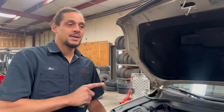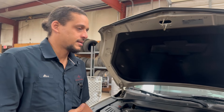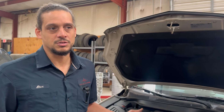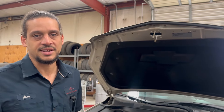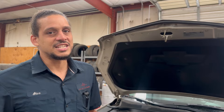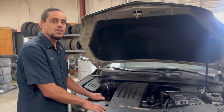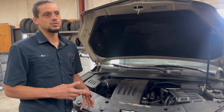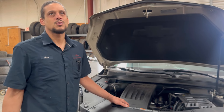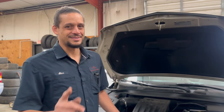I'm going to do an honorable mention because I don't see it a lot in my shop, but these engines do like to consume oil. Let's say you have 6,000 mile oil change intervals using synthetic oil — you're not going to make it to that 6,000 miles without adding two to three quarts. That's an issue. What you can do — I always recommend to my customers — if it is consuming oil, you most likely have piston ring issues or some type of internal issue. You can use a product called Lucas Oil Stop Leak. It works very well and will help you extend those intervals without adding oil.